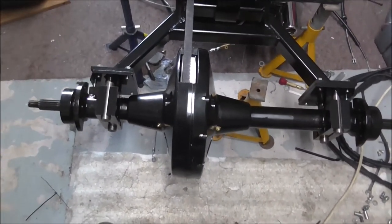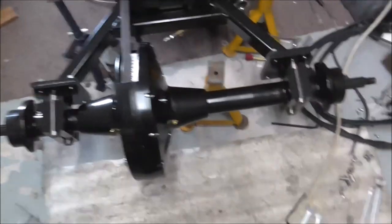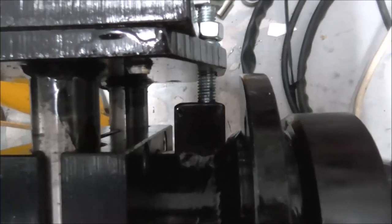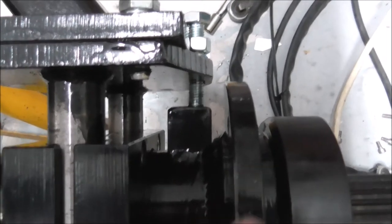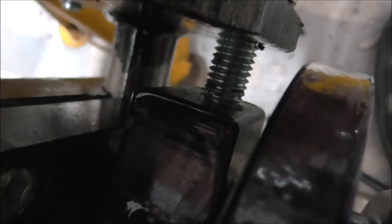The axle's back on and slightly adjusted — belt tension is near enough where I want it. As you can see there, that block there is the one I was welding — that bit is for the mudguards to bolt onto. As you can see, I've left this loose on purpose. If I screw it out, you can see the hole in the block, so that when you tighten the screw in it goes into that and it can't slip off anywhere.